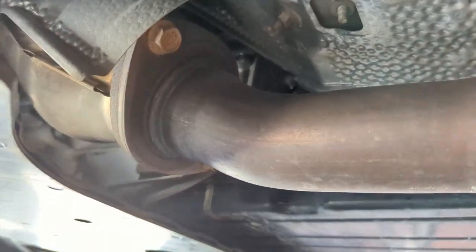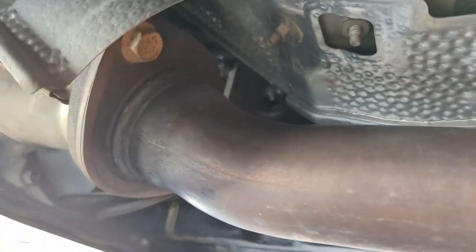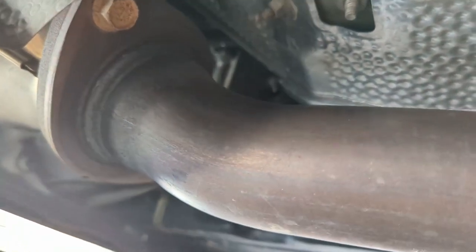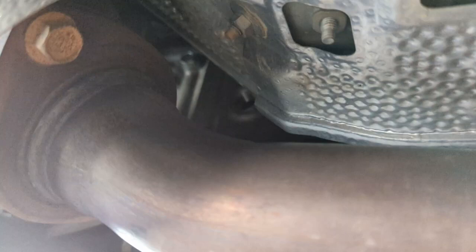Basically, you need to use some kind of hose or pump to get the transmission fluid in there. It's 24mm. It is hard to reach without an offset wrench. You can accomplish this with a regular wrench, but it may take some effort. Once you remove this, it will also require a new O-ring. You can get all this at the dealership.